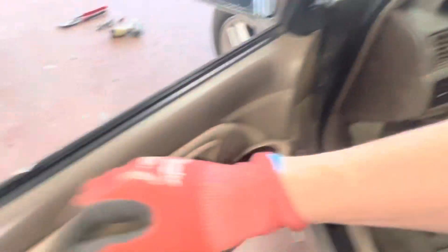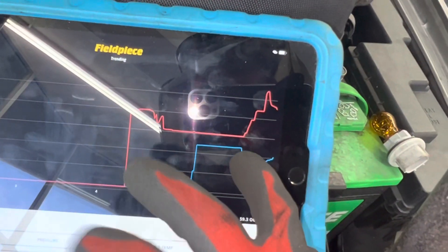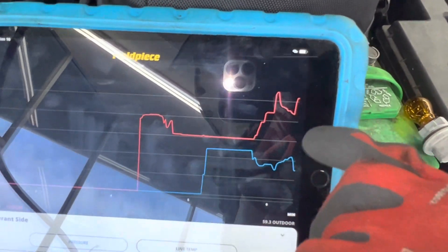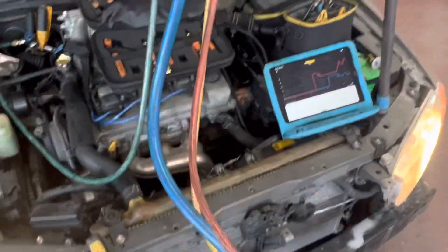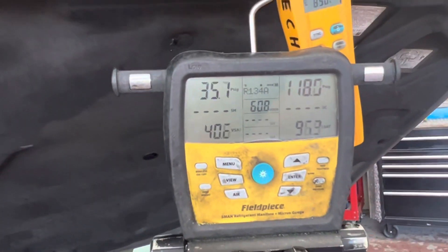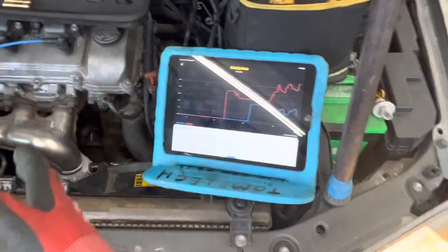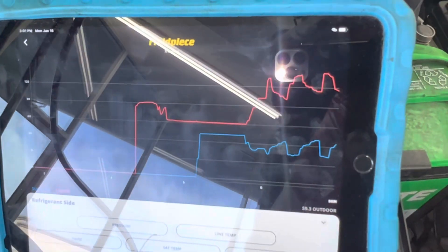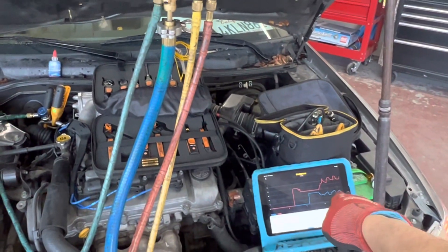All right, let's see what's going on. We got to bring the screen back in with us. We can see the absolute moment right where the compressor kicked in and the low side went down, the high side's going up. We just went up over 120. It is a little loud in here. So I'm going to let this run for a few minutes and come back to look at this vehicle. This is how it's running right now, started up for the first time right after it was recharged. See you guys on the next video on this car just to see if the pattern has changed any.